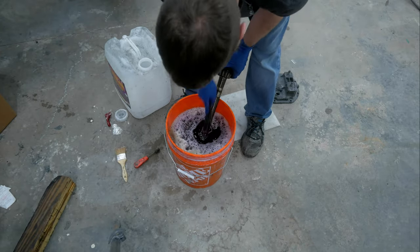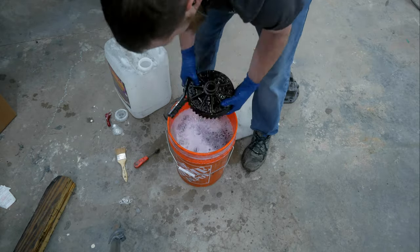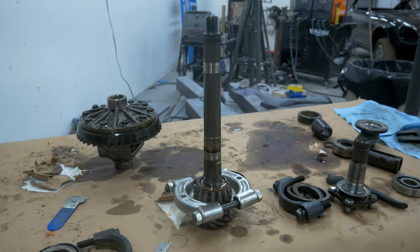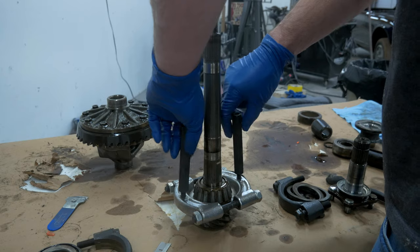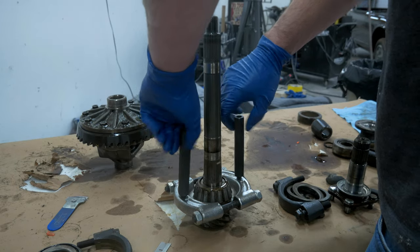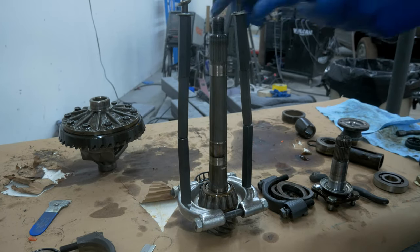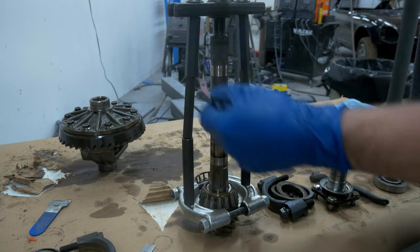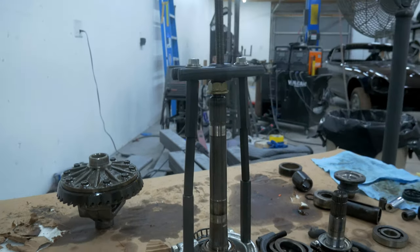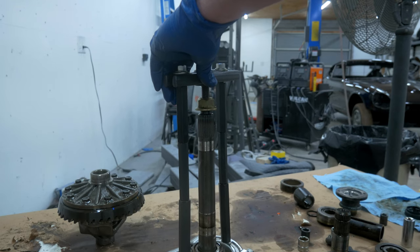I bought all of these bearings on Rock Auto for various reasons that maybe we'll get into a little bit later on in the video. But there were some part numbers listed for the R180 rear end under the part number interchange for the 1978 Datsun or Nissan 280Z. So just keep that in mind. Those are pretty generic when they start running all that stuff together, and they do have incorrect part numbers and seal numbers in there. So you might want to click on the ones they have listed and measure it and see if it matches what you have. Just a little buyer beware information there.